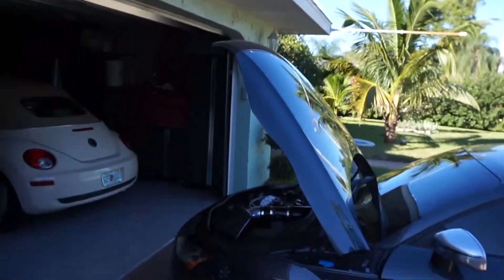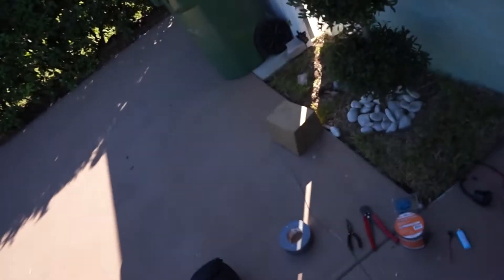Hey guys, I'm here with my Audi TTS and today we're going to install an ethanol gauge because I want to start doing a little e-blend on the TT. You don't want to run e-blend while just guesstimating the numbers — you'll want to know exactly what's in your car, because these cars don't readjust automatically. I do have an app, I'll put the link in the description, that makes it very easy to calculate the percentage you'll be putting in your car.